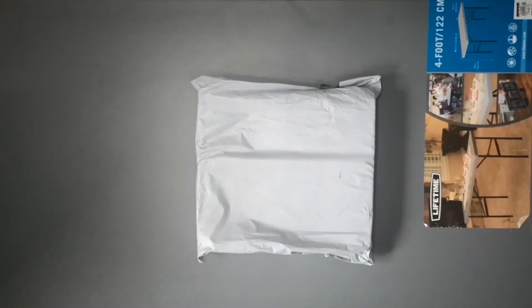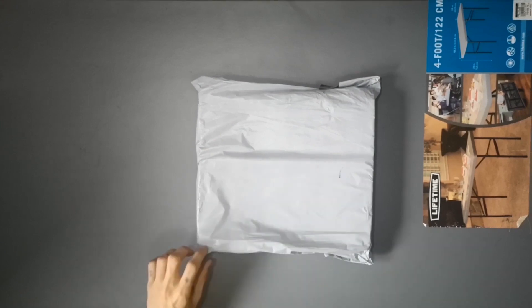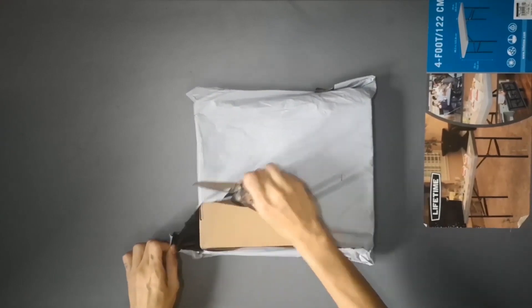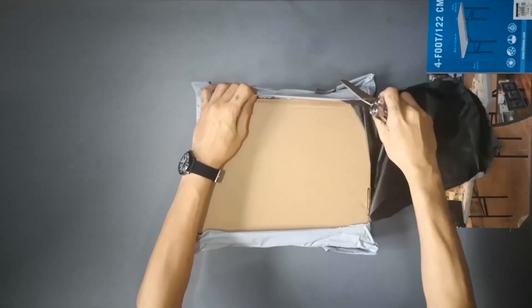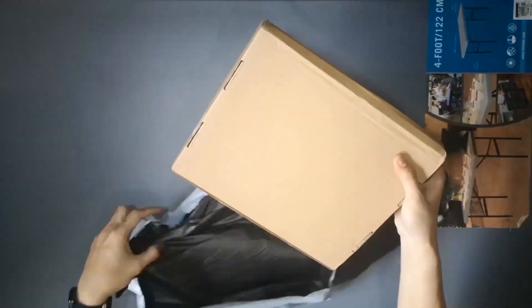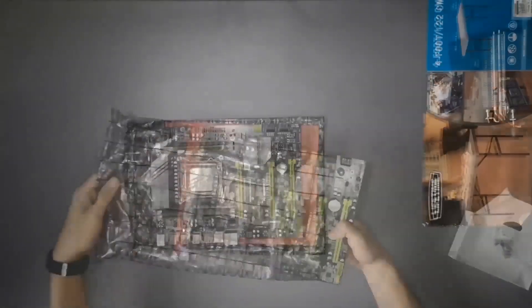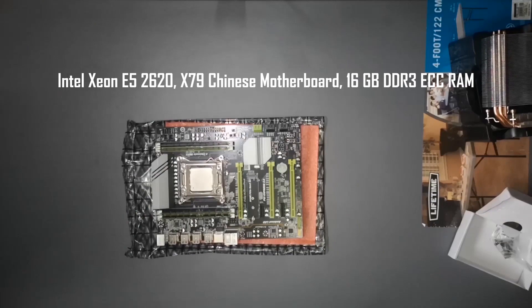With that out of the way, let's go to the parts list. The parts I've chosen were based on what my needs are and what my budget can get me. To clarify, this video was not sponsored by any manufacturer or brand — all of the parts I'll be using were purchased with my own money. At first, I was planning on building this system around the Intel i3-9100 CPU and 32GB of RAM, but I happened to come across a bundle of a Chinese motherboard, an Intel Xeon E5-2620, and 4x4GB ECC RAM for less than $105. I did some research on these Chinese motherboards and was surprised that they are quite popular — there are even Russian forums for these motherboards. As this was a budget NAS, I opted for the bundle instead. Considering that this is a server build, the 6-core 12-thread Xeon CPU and ability to run ECC RAM was a pretty attractive deal.